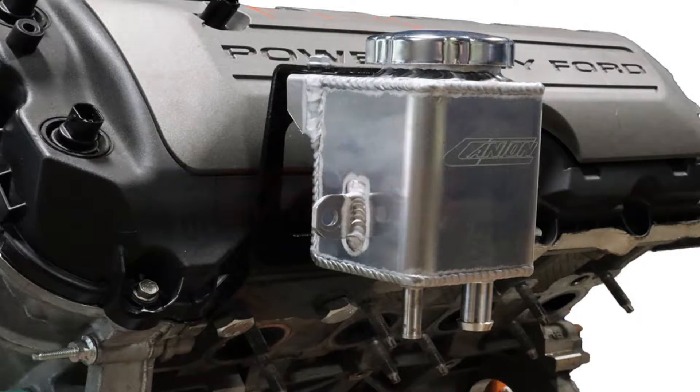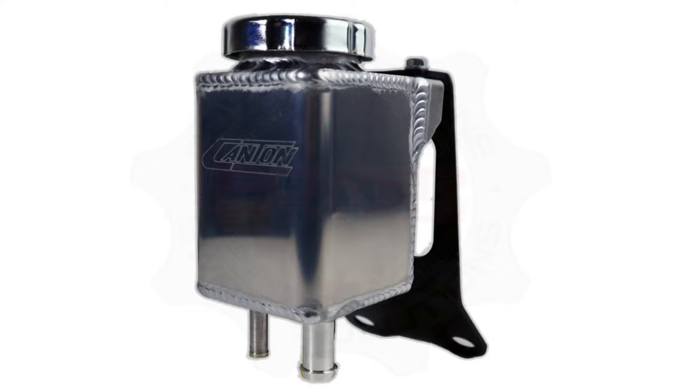What we have now is a really neat solution from Midway Mustang. They have a bracket that occupies the vacant engine lift bracket on the driver's side and gives you a spot to mount a power steering reservoir. The position of this reservoir is key because it puts it right above and directly behind the power steering pump in your speed drive. Gravity feeding the pump is a big part of its use, so you want to make sure you're supplying power steering fluid without any interruption from the reservoir.